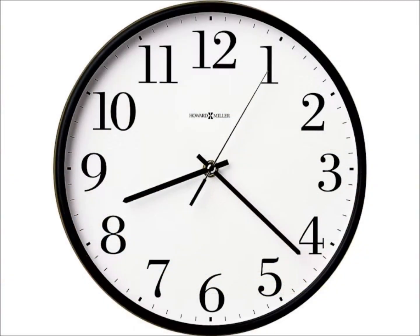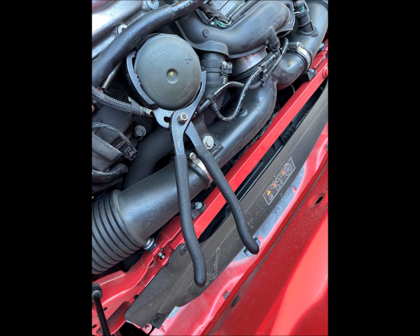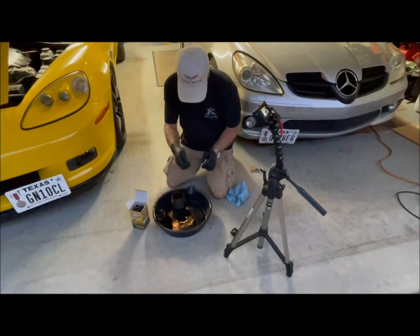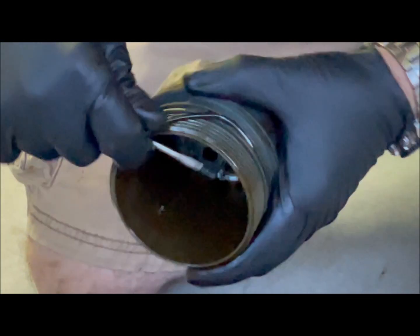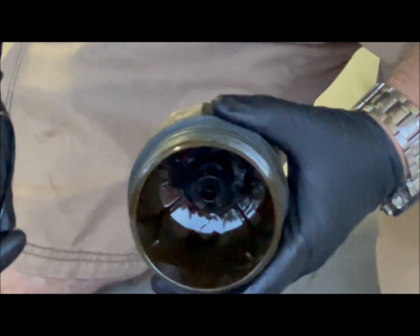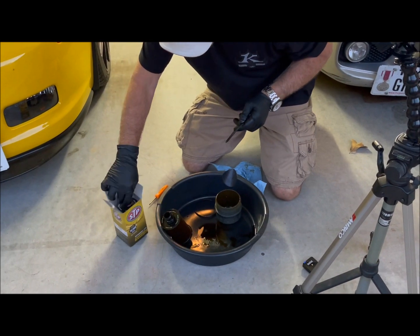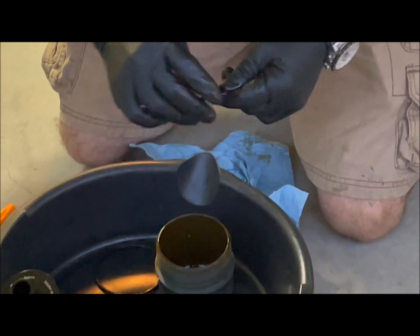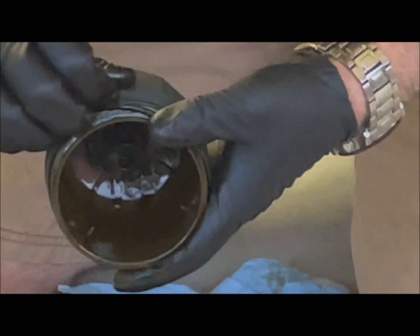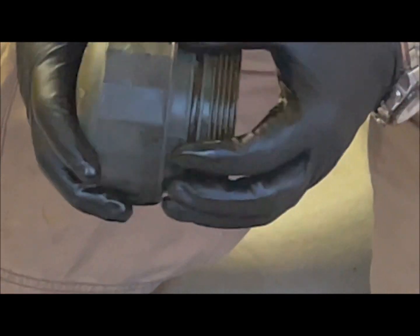Take your time if you can. While the oil is draining, you can remove the oil filter. Remove the cap and the filter will come out with it — perhaps use a second oil pan if you have one. Remove the filter from the cap; it just pops out. Remove the O-ring from around the cap — you might need a small tool for that. Take some fresh oil and oil the O-ring that goes around the cap and perhaps even the grooved areas where that O-ring goes on the cap. Don't have to go crazy with it.